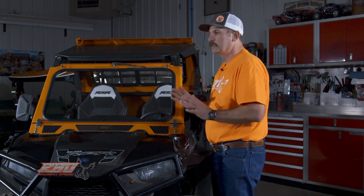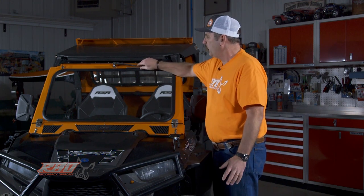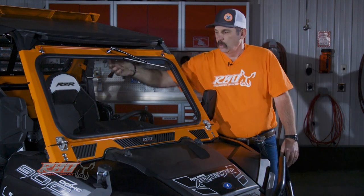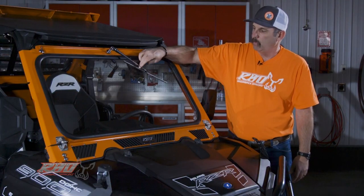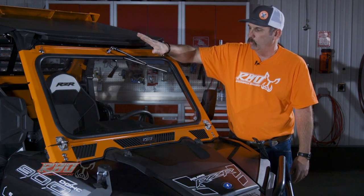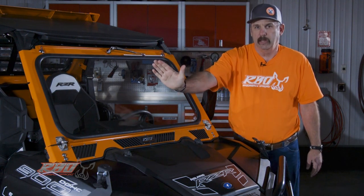I really hope you can see all of the effort that went into developing this windshield. We also put a windshield wiper in it — we designed it as a manual wiper, and this is optional. You can use it when you want. But we didn't want it migrating down when you're driving down the road, so we designed it so that when it's not raining out, you simply set the wiper above the windshield gasket, and that prevents it from sliding down.